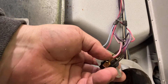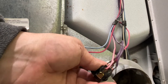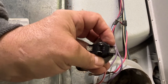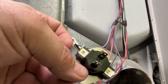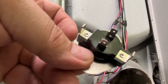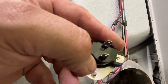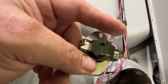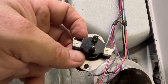Now you can't hook this up wrong — the spade connectors on the two outside are much larger than the ones on the inside. This is the switch which we're going to test. It's got the model number on it: 3387134, and then it says 155 to 25°F Fahrenheit. So that tells you that 155 degrees Fahrenheit is when it trips the switch inside there — within 25 degrees or maybe 25 percent, I'm not quite sure, of the 155. So we're going to test to see if the switch inside is fried and that's why our dryer isn't turning off.